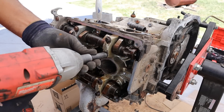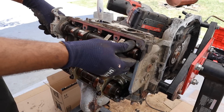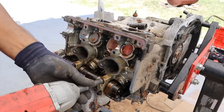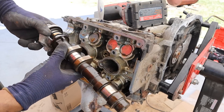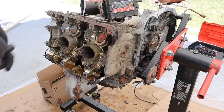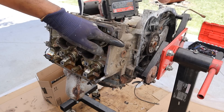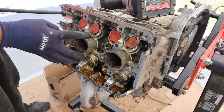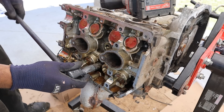Let's get these camshaft caps out of here. The camshaft itself doesn't really look worn. Here we have the camshaft seal — getting the exhaust cam off, this one looks pretty good too, not overly worn. I also have these knockouts here that allow the camshaft to poke through and power accessories in other models. Now I'm just going to crack these head bolts loose. This is also one of the weak points on these Subaru engines — these bolts could actually come loose, causing the same issues as a blown head gasket. This is a 14mm 12-point socket.